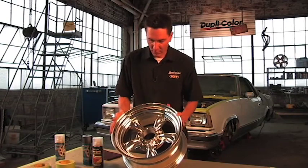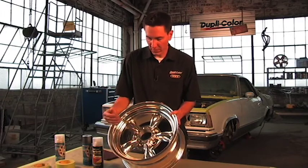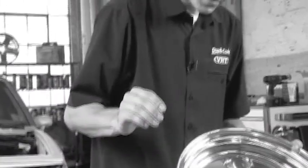What I'm going to want to do is scuff down the area to be painted, because sometimes these polished aluminum wheels are clear coated. You're going to want to scuff it down and break that glossiness so the paint has something to bond to. After that, I'm going to use the Duplicolor prep spray, and then the wheel coating on top of that.